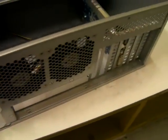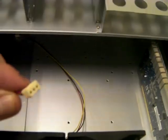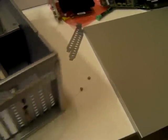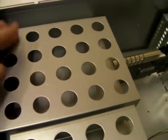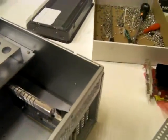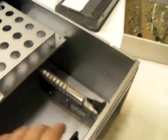As before, it will take a standard ATX power supply. We've retained the two 80mm fans at the rear, and we've gone for three pin plugs as opposed to Molex connectors. We've still got the seven expansion slots, and there fits your 5.25 CD-ROM or other device. This takes micro ATX, standard ATX, and even a 12x13 dual processor boards.